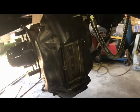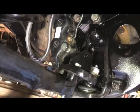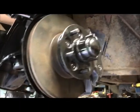I'm not turning this into the Jaguar channel, but if you are taking one of these apart to rebuild it - while it is very simple, take pictures. It's quite the engineering marvel - everything is kind of like a puzzle, pieces are laying over top of each other, bolts go through multiple pieces, and everything has to be assembled in order. Otherwise you have to take things back apart. So take pictures, write it down - it's easy but if you just have a pile of parts on the floor it can get confusing.